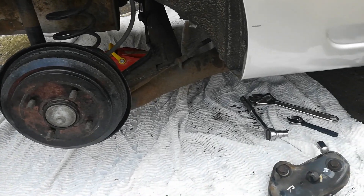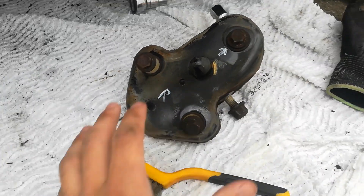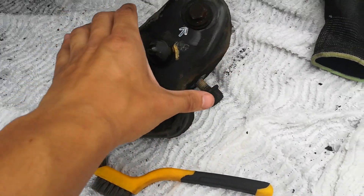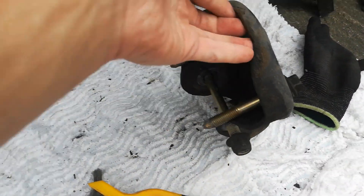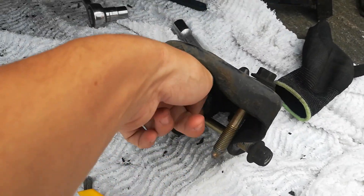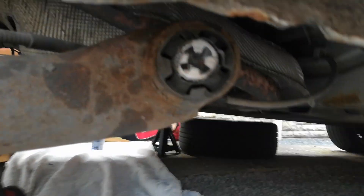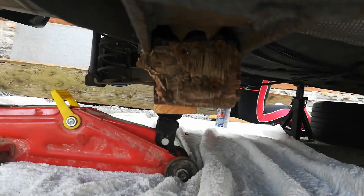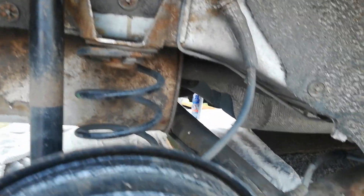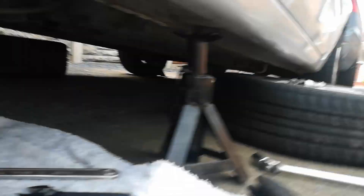This is the state of the car at the minute - we've got the right-hand side axle mount that sits in the top of the car. Your axle actually sits into there and is held by this pin. It goes straight through this bushing, and this bushing is held up into that space just up there. At the moment the actual rear axle is being held up by the jack, some wood, and the shocks and springs basically, so we're just working on the other side after we've done this.